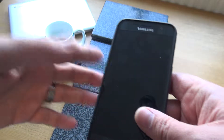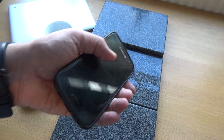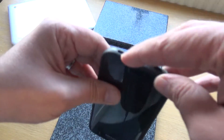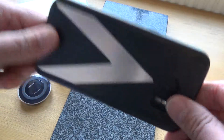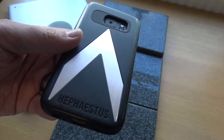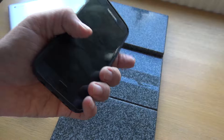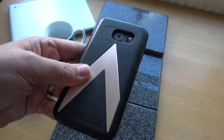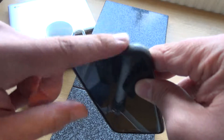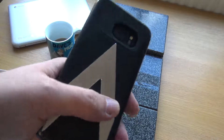If you absolutely have to use wireless charging — our younger son loves it — let me take the phone out of the case and pop it on the mat to show you it's working. There we go, it's charging. So this is largely to do with the metallic brushed aluminium insert on the back, which is going to interfere with the current reaching the coil on the back of the battery. Let's pop the phone back in the case and place it on the charging mat — nothing. I can even spin the phone around to try and get the current through — absolutely nothing, it's just not letting anything through.